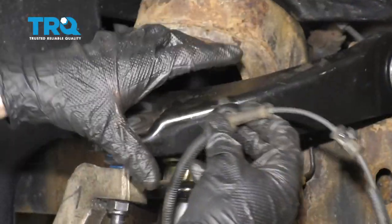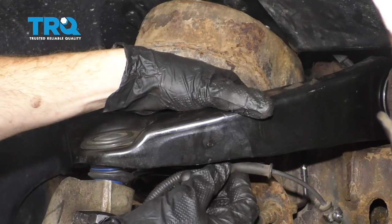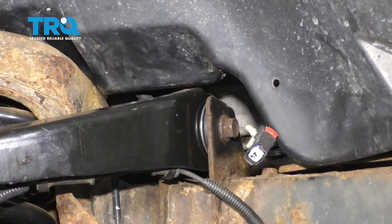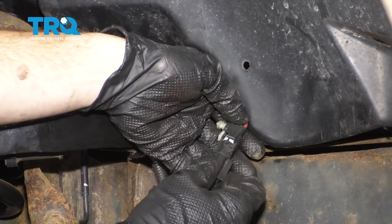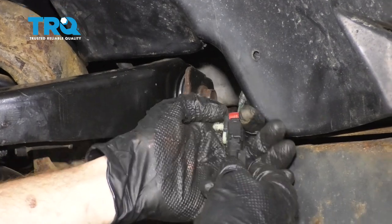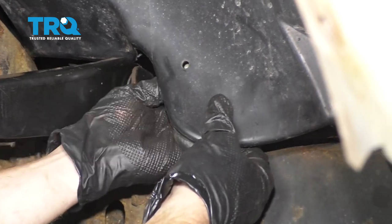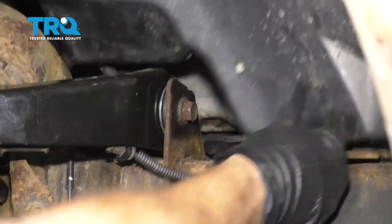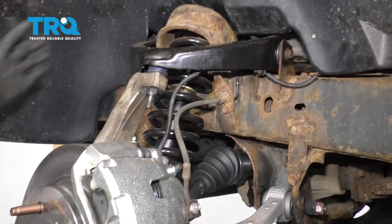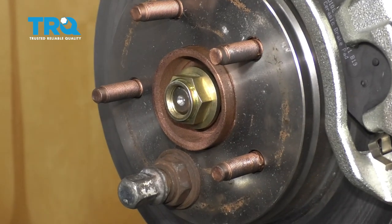Now it's time to re-secure our ABS wire here. I'm just gonna look underneath the control arm — you can feel the slots. Slide that one up in there. Connecting our wire — give it a nice click and a nice tug. Click it in there, give it a tug, lock it in. Push this back through. Make sure your ABS wire isn't gonna get caught anywhere. This looks good. We're gonna put on our axle nut, then we'll bottom it out and torque it to 185 foot-pounds.